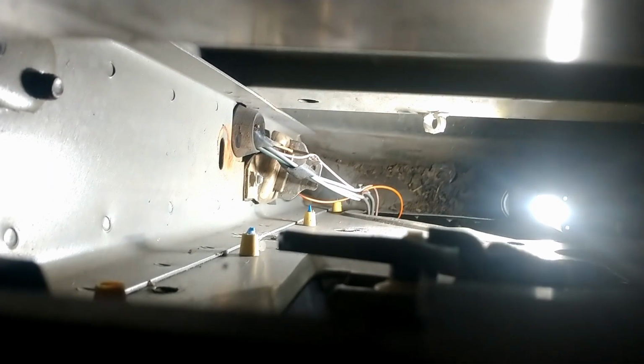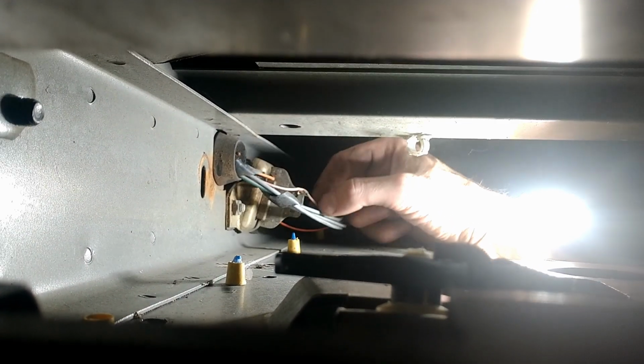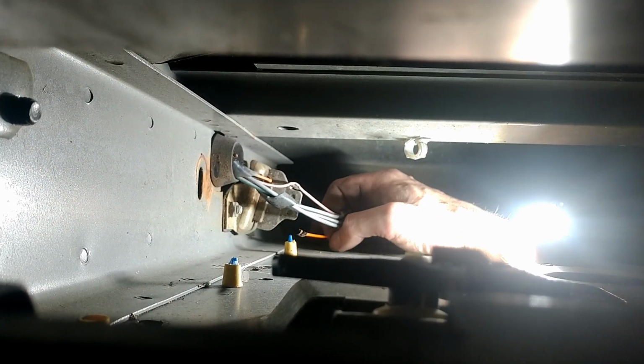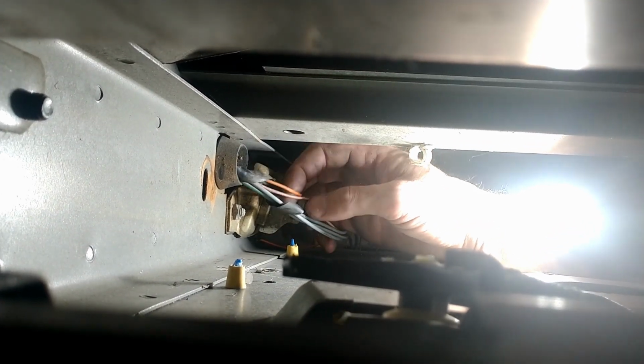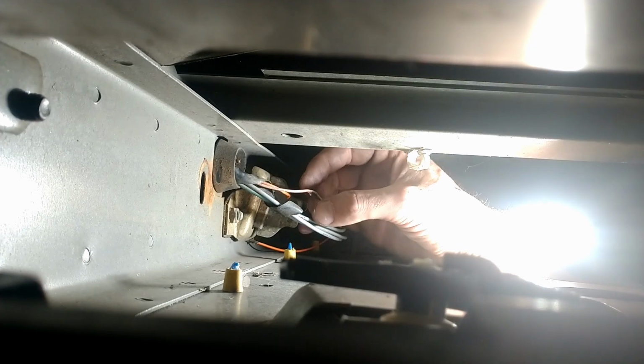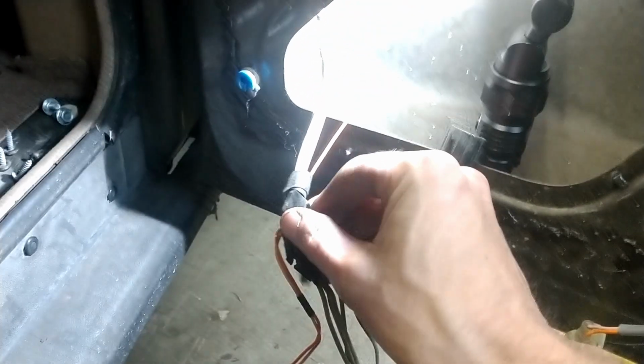There we go. What you'll notice is this orange wire, well, half of it's here, part of it's here. The other half got pulled into the door tether. This one here almost suffered a similar fate, but just got super chewed up. So we have some wiring to repair. Since I've gotten this disconnected, I think what I'll actually do is pull it back through the door, maybe? Through the harness there. That way I have the full length I can work with, and I can repair that.